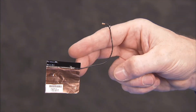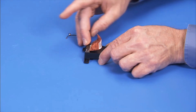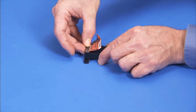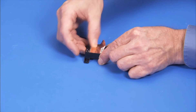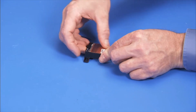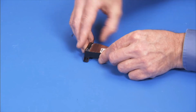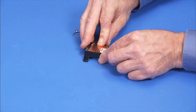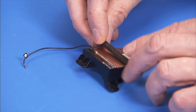To install a new main wireless antenna, press the antenna adhesive and foil tape down onto the main antenna bracket. Then place the foam gasket for the main antenna over the foil tape.